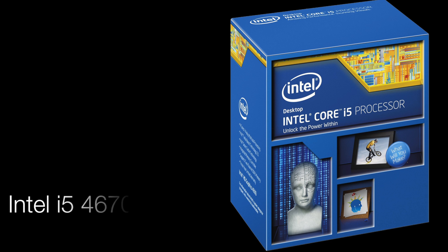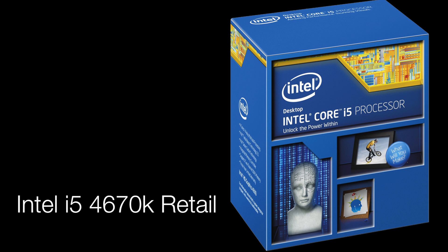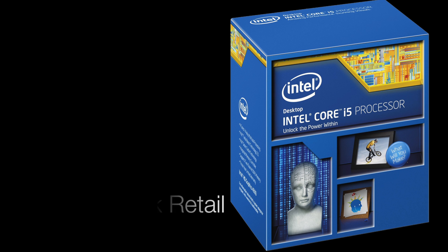On to the processor — this is the Intel i5 4670K, which is easily clockable to 4.5GHz. Now some might be debating why I didn't put the i7 in. Well, there aren't really that many games that utilise 8 cores, which is what the i7 has. The i5 only has 4 cores and as it's clockable to 4.5GHz that's plenty good enough for today's games and probably games coming out in 2014. We've also got to bear in mind that we're trying to keep this build at a fairly reasonable price point.